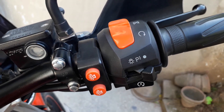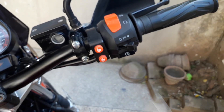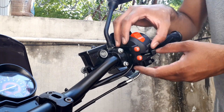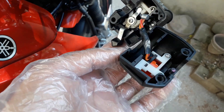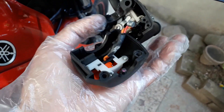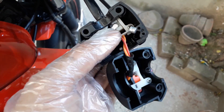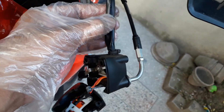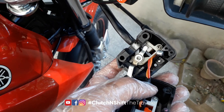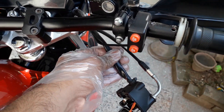I need to open this to show the wiring. I need a plus screwdriver — there are two screws in it. I opened the assembly. The upper part is where I bought the aftermarket; the lower part was genuine and the quality was good. Inside the kill switch there are only two wires — one is red and one is orange. I took these wires, connected them to the main wire, and sent them to the headlight area. The length of the kill switch wire in the assembly was not enough to reach the headlight, so I took a good piece of wire to extend it. The connection goes to the ignition coil.